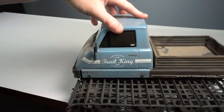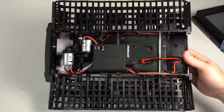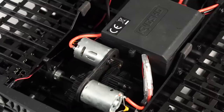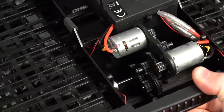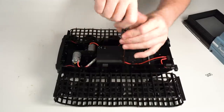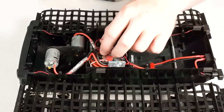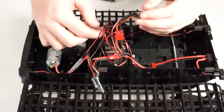With the chassis of the Trail King exposed, you can see just how simplistic this chassis design is. It's kind of boxy but all open, and it's really easy to access everything for repairs or maintenance. Up front are two 370-sized motors, one to power each side, with a simple gearbox setup for each side independently. In the center of the chassis is the receiver box with an attached lid, and just behind that is a single Velcro strap to secure the battery and a T-style connector. Inside the receiver box it's all pretty simple — two speed controllers with LED wiring all connected into the receiver.